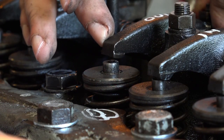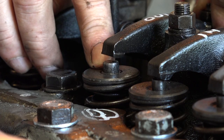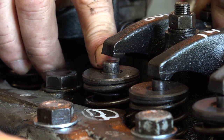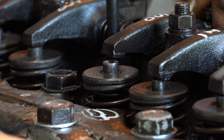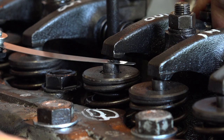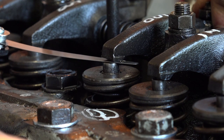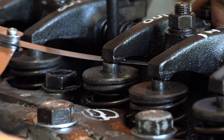Here's a close-up on how we actually do it. You can see the play between the top of the valve stem and the rocker — that's where the gauge goes in between. Then you need to adjust the rocker so that the gauge is slightly locked but not too much; you should still be able to move it back and forward. That's the trick.